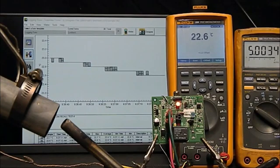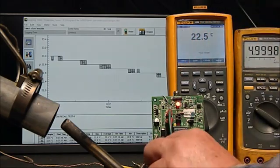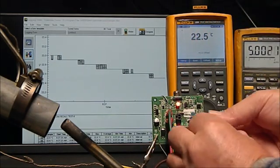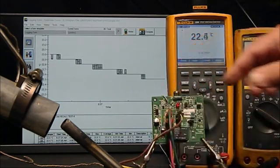To start the test, the Norcold sensor is disconnected from the Norcold control, thus the flashing red light. We then install the Norcold sensor, which stops the red light from flashing and allows the Norcold control to turn on the blue light, which simulates the fridge running.